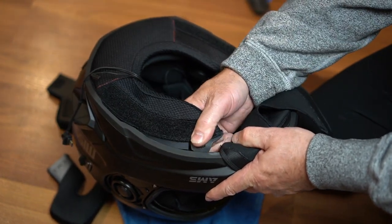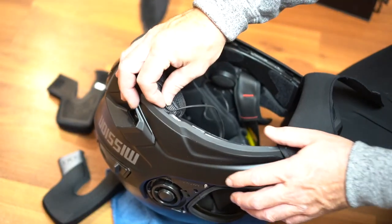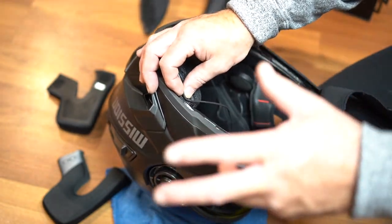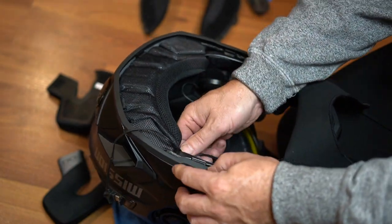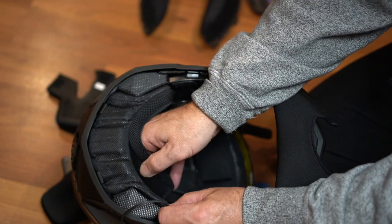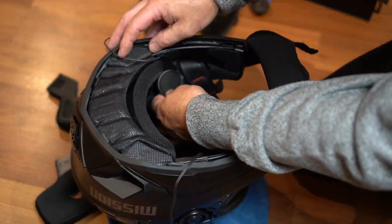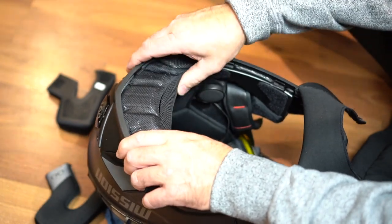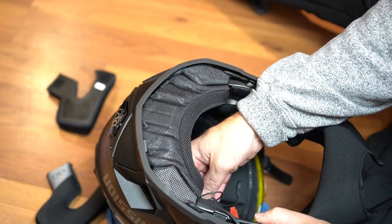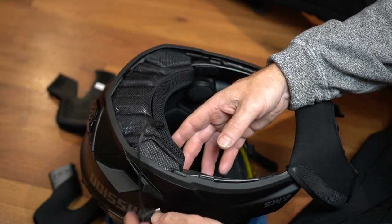Now we can have a look at the wiring. This liner will pull out just by pulling up gently on it, so we're going to pop this rear liner off. I like to mount the control on this side of the helmet so I can use my left hand to control it, so we'll give ourselves a little bit of extra cable here and that can pop out there. We'll bring this velcro inner liner back — that's where we'll tuck the cord going between each communicator. Once you've got the cord in place you can velcro the liner back in and just make sure the speakers are put back onto the pads if they fell down.